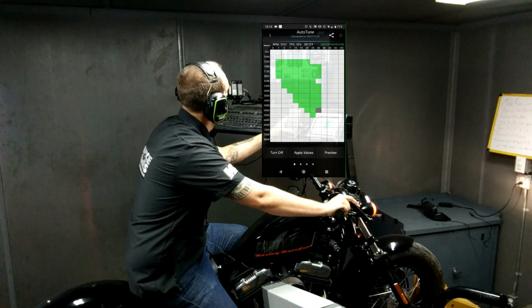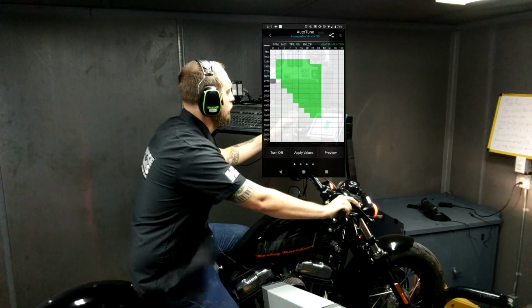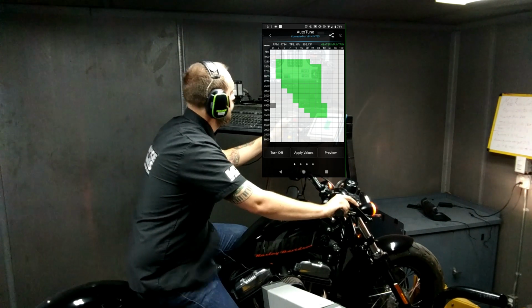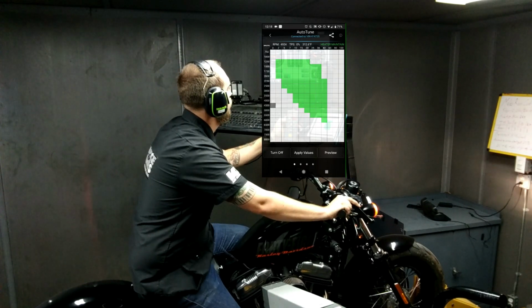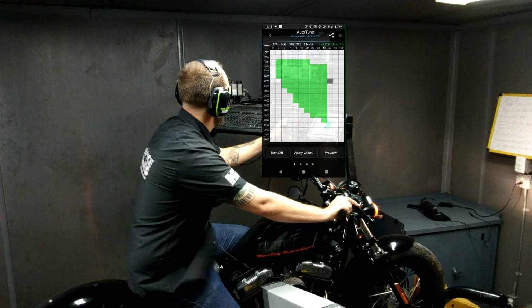As I get towards the top of 25 and 40, I will sometimes disable and then re-enable the load, almost like a simulated step test, just to make hitting those higher RPMs a little easier. So as we continue ascending order mapping here with our columns, I will go ahead and say a few things. This entire mapping session was performed in a little under 15 minutes.